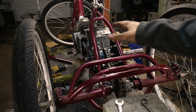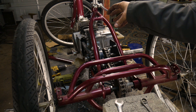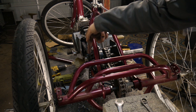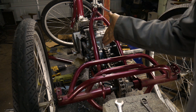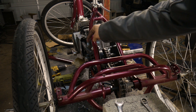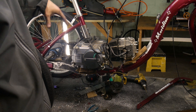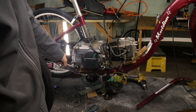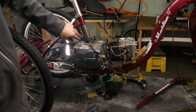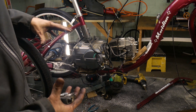The jack shaft is all set up and I'm really happy with it. I drilled and bolted on our steel piece and now it's nice and sturdy onto the aluminum frame. I did have to move the bearing on one side and sand it down a little bit so it would fit in between — that was just because I needed room to put the sprocket here to line up properly with the motor. Since the jack shaft is mounted, I can now finally move on to the motor. I'm going to bend some one-inch tubing and connect it from this bottom part to this tubing right here, and then another one-inch going all the way over the engine and connecting to the front — that will give us a nice sturdy frame.